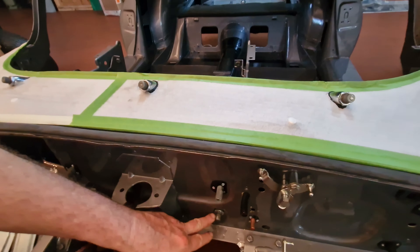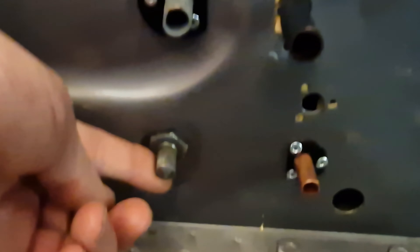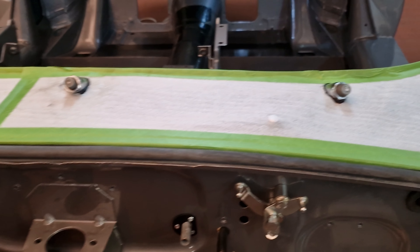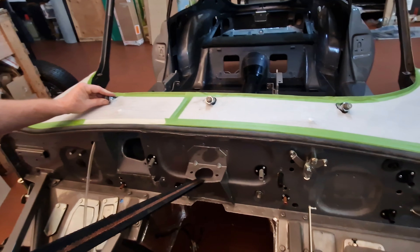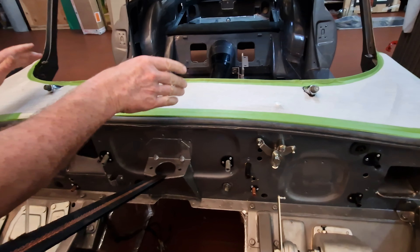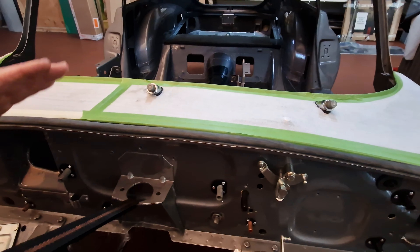There is a thing you need to know: when the painter does the bodywork, these holes get smaller than the spindle itself, so you need to grind that out. Don't try to push the spindle through, as you would crack or split the paint. Then you fiddle the wiper adjuster — that's the automatic stop function for the wiper motor — through here, get the nut attached, then mount the outer spindles and fix it. That's all in here now. I have the new rubbers in there. That doesn't mean I can't access this later — I will check it again at the end.